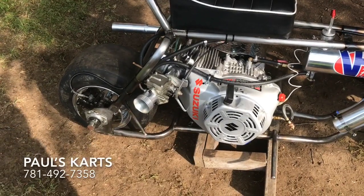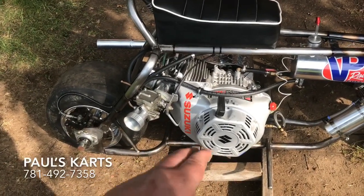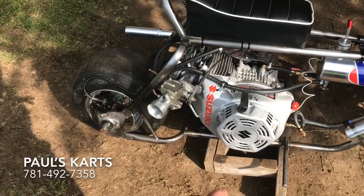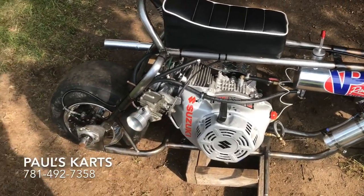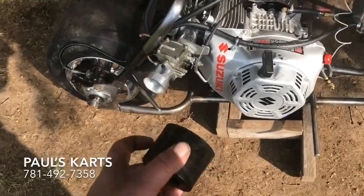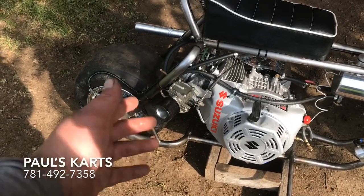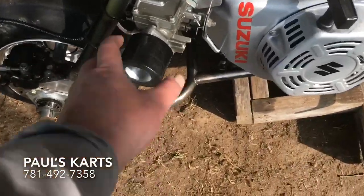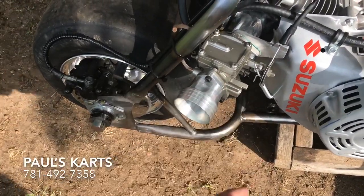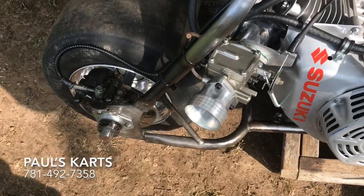So I'll tell you exactly what I did. The way you can mess with the fuel signal is if you have a lean condition on top and there's nothing you can do about it — you just can't get enough fuel. What you need to do is get a little bit less air but still be at wide-open throttle position. So how do you mess with the fuel signal? For example, this is what I've done on mine. I took a spray paint cap, cut a hole in it, and put it on the carburetor. You can do this with various sizes — you can do this with pieces of billet plate. On these carburetors there are three bolts that come off, and I know they do that on high-end race engines. They'll take off the manifold and have a piece of billet cut with the perfect size drilled hole, and use that in combination with an oversized carburetor to get the maximum amount of power out of an engine.